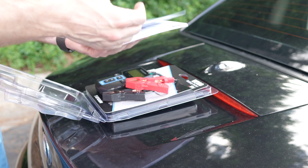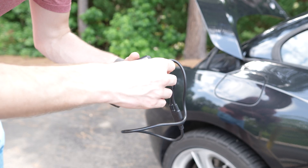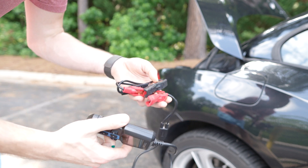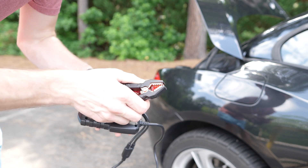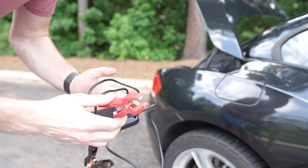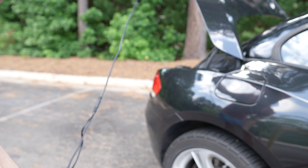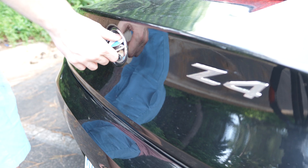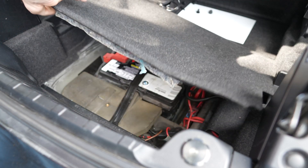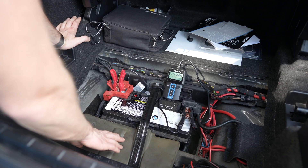The device itself feels pretty durable with nice and strong alligator clamps, which is pretty important. The BT100 gets its power from the battery itself — as long as you have no less than 5 volts, it can still be powered. The accuracy rate for the 12-volt battery is 95 percent.